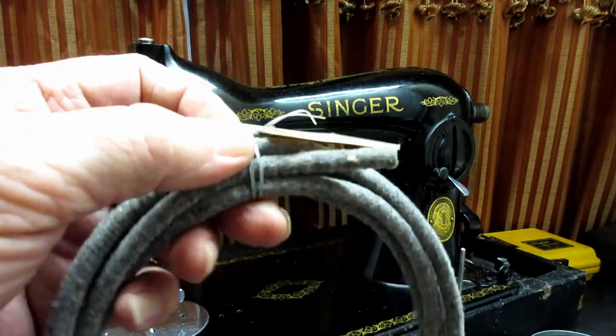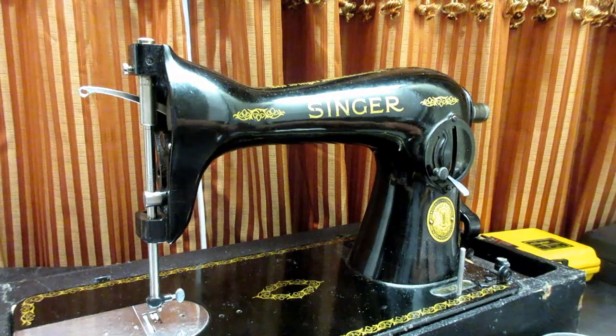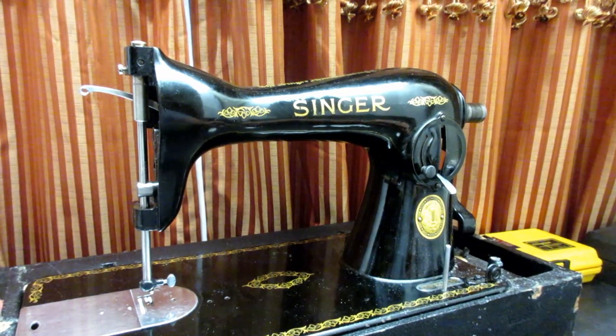Isn't that pretty — all clean, smooth, adjusted to the right height, with the needle clamp jib and thread guide all ready to go. That concludes the video of the needle bar system of the Singer model 1591, in this case named Ike — good looking little machine so far, with a long way to go though. In the description below the video I'll put a link to the McMaster-Carr firm felt cord page for anybody interested in felt pads or wicks used for oil, in different sizes and lengths. Thank you so much for tuning in — I hope you felt it was worth your time, maybe you learned something, and I hope you'll come back and watch more of my videos.